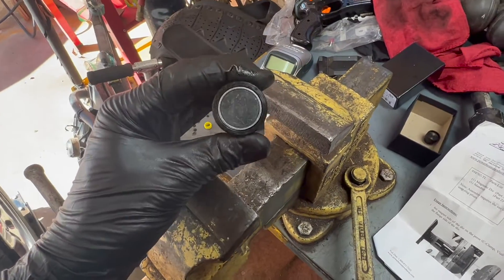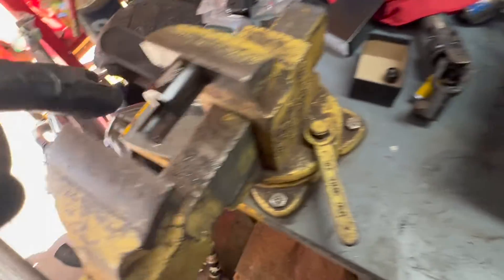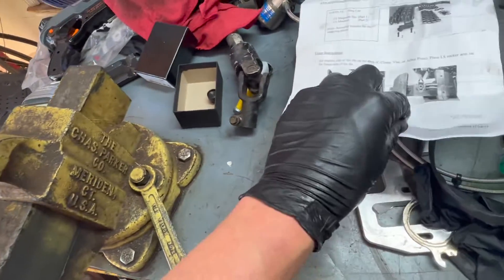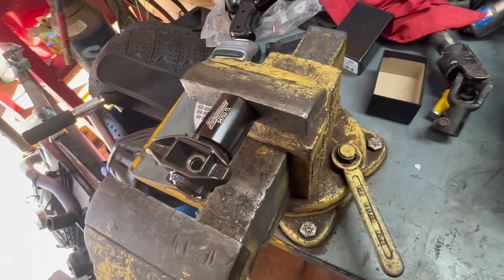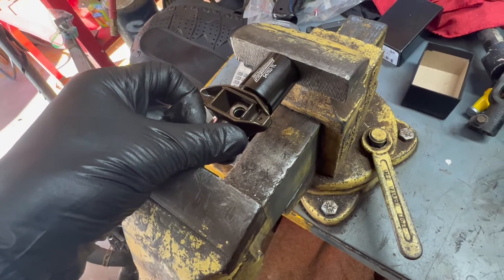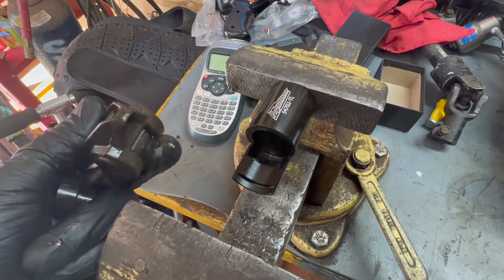It's magnetized, which is pretty awesome. Pretty much what I gathered is you set the tool in the device — you're going to set the rocker arm in because you can see it's grooved in like so. Then on the next page, we're going to take our other tool and place it against it, push it out and it's going to shove out that way. This is the offset one, which is for the rectangle port heads.